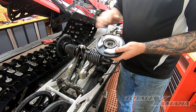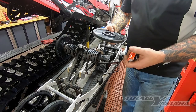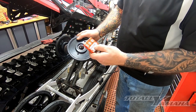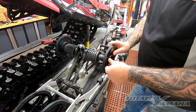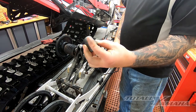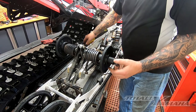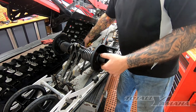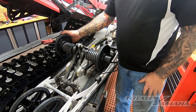Once I pull both wheels off, I can do the bearings and show you how I put them back on. These upper wheel bearings are 6006 FAG bearings. To put this back on, because it is a slight press, I have a bushing that is perfect to the inside race so it doesn't put pressure on the bearings. You just tap it right on and then put the arm back together the way you took it off. That's basically how it works.